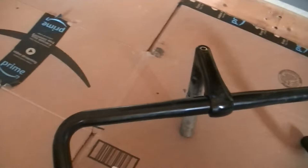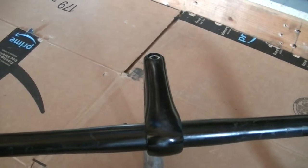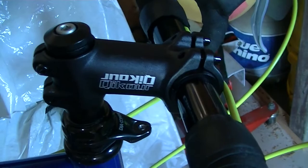So, this was not the original handlebar. The original handlebar was for a person who was quite a bit taller, and they had a big 160-millimeter drop on the bars. I did upgrade the bars and a quill stem. Interestingly, this bicycle had a spacer in it because this is an old 22.2 quill stem — I didn't know that, otherwise I'd have got a 25.4 quill stem. But up on the bike I went totally modern — I believe they're called threadless stems — with a stem adapter. It's an 80-millimeter reach and a 26.0 bar.